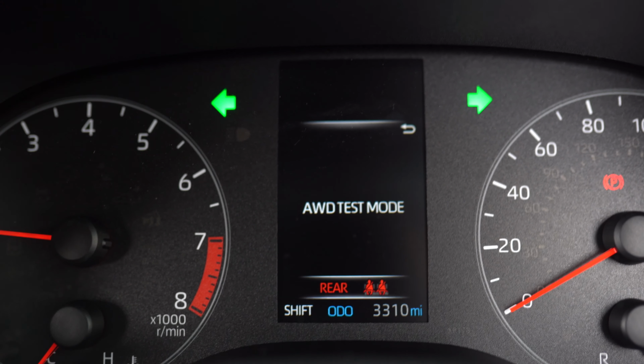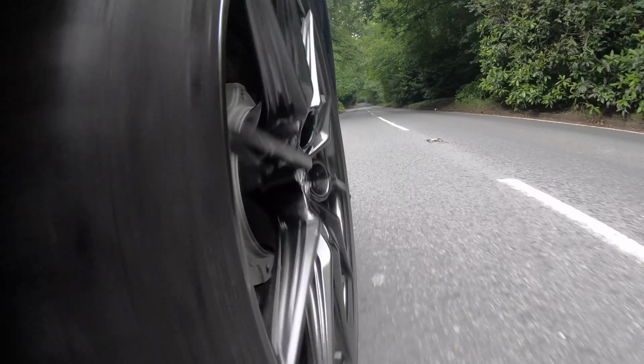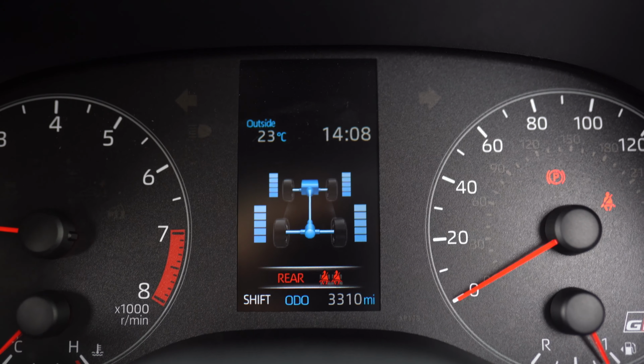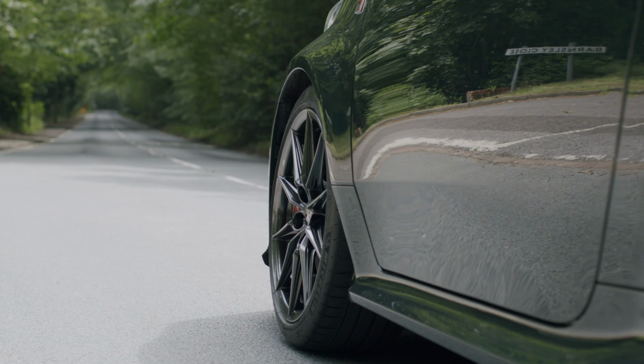The additional selection modes for switching between sport and track allow you to feed into the Syvecs ECU and adjust the base duty on demand as well. We also offer the ability to have a potentiometer fitted to the unit to allow you to adjust it on the fly, actually on the track. So a real qualified racing driver might find if they're getting a little bit too much understeer, they can back it off and put some more to the rear.